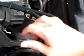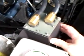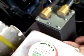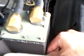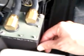I'll show you what I used for the filter media. There are 3/16ths holes down there — it's bent at a 90-degree angle about 2 inches from the bottom, 16-gauge steel welded. You can kind of see some of my welding. I got metal to stick together — I won't call myself a welder.